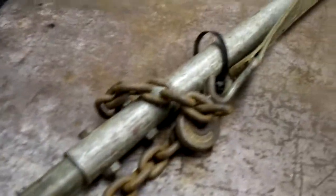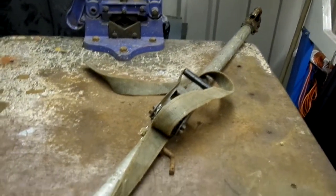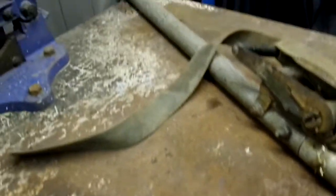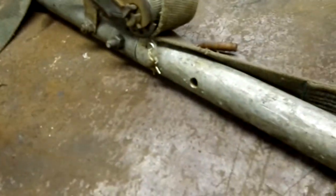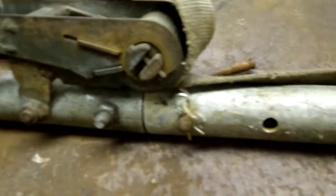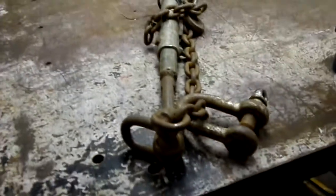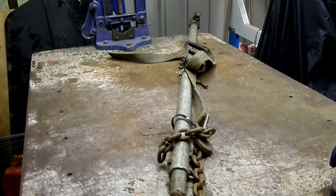So if someone wants to make a good, solid, heavy-duty tow pole, I'd say do something like this. It's very similar to the AA and RAC ones - that's what you'll be looking at. You can do it out of scaffold tube or steel tube - 2x2 box if you wanted. I'd go for scaffold tube because they're galvanised and thick. I was lucky enough to have aluminium tube. Pull the pin out and it comes apart for transport, fits in your boot. So that's my homemade, heavy-duty, straight tow pole. Please like and subscribe - thanks.